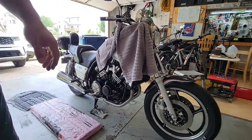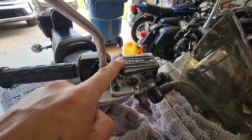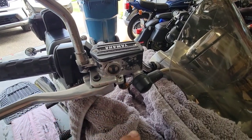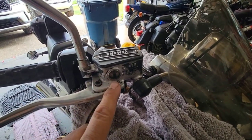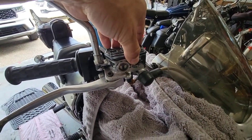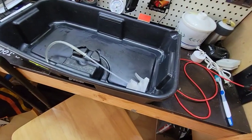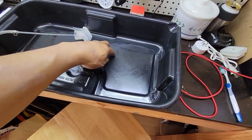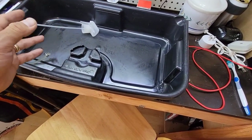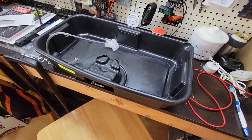So next steps, we're going to remove these bolts, we're going to remove the cover, the plastic, and then we're going to drain all this oil or fluid, brake fluid, to a container, and then I will remove the two bolts from the back in order to take the master cylinder to my work area. So I will have it here, and then it's plastic, so all the corrosive fluid will be in plastic, not metal, so no metal reactions or something. All right, so I'll be back.